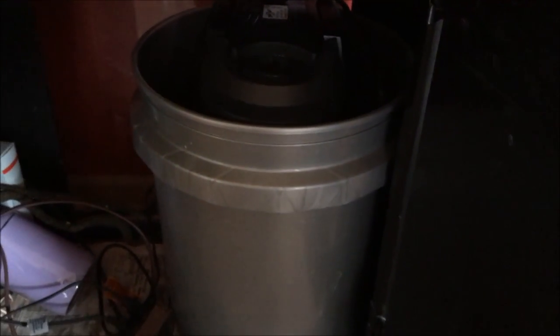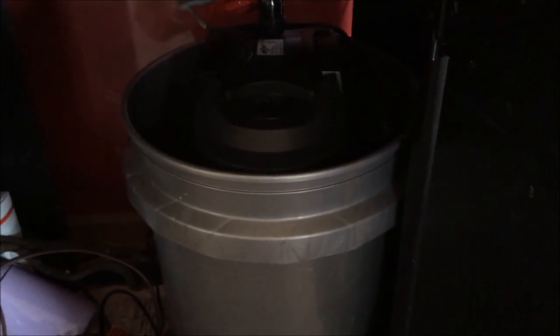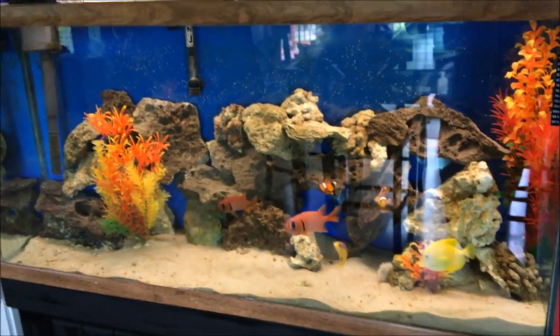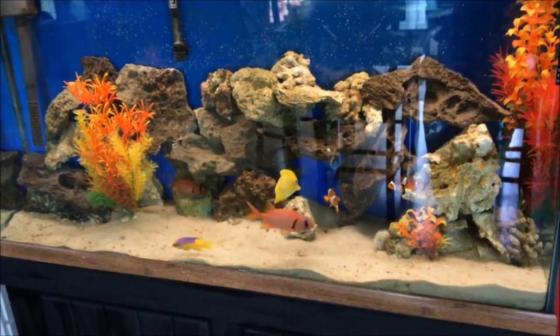It had just been floating around in the basement. Found it, got it suited up, brought it upstairs, plugged it in — leaks all over the place, water gushing everywhere. It turned out to be the gasket on the priming cap. That thing was pushing out air and shooting water, about a gallon every two minutes. So I took some electrical tape, wrapped it up, and it seems to be holding the water pressure pretty well. Keep that in mind — the Zoo Med canister filter definitely leaks through that little seal.